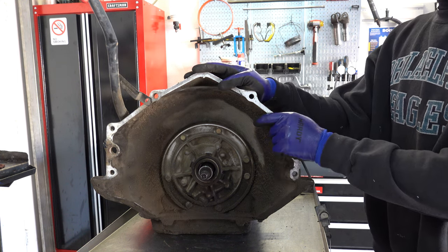Okay, get your pump filter out. Make sure you don't forget to reinstall the new one when you go back together, otherwise you'll have no movement. The pump won't be doing much of anything. All right, that's the stator pump cover. Now let's take a look at the body. So here's the body, 10 vane pump.